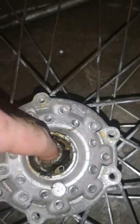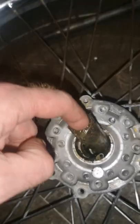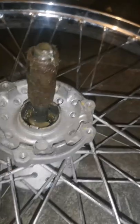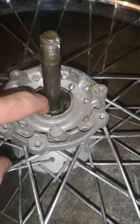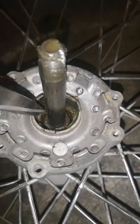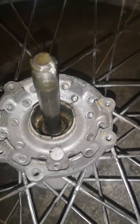So on the other side now, I've greased all in there. I've greased that pin. Now I'm going to get the spindle through there. And that's the spindle through. And that's the spacer. So just put the spacer all the way down so we know it's in the right position. Just need to go down a little touch more, just so it's in line with the ledge. What I showed before, put the grease in where the bearing sits.